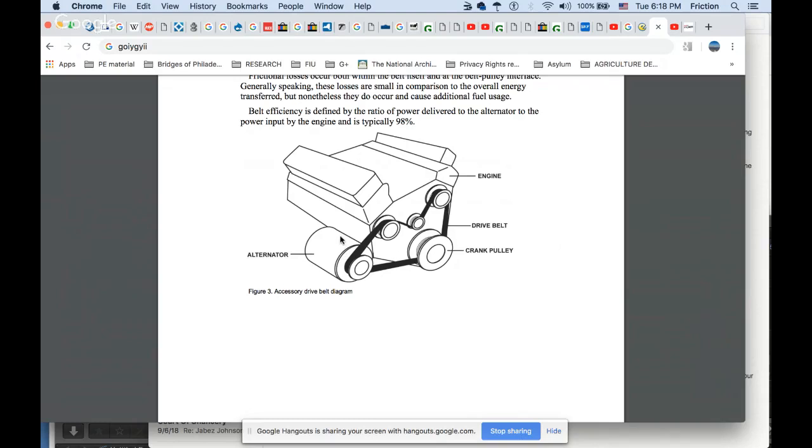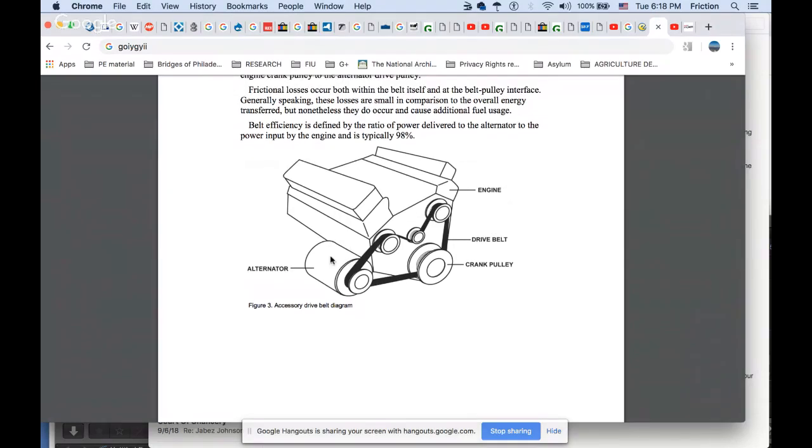And you can figure out its range again by looking at the packages. If you find you have a Jeep and it says, "Oh, we got the extra headlight, runner bar lights," and you look at the original equipment package and it has the same alternator as your non-lighted Jeep has, well, you can say, "Oh, I don't need a bigger alternator. This has already been designed to take more lights on that single alternator." So it's been over designed by that little bit.